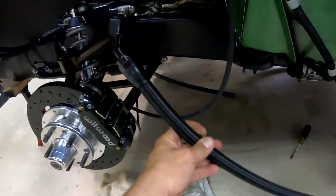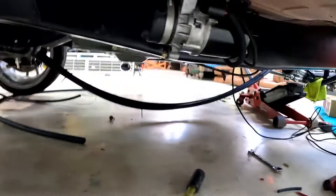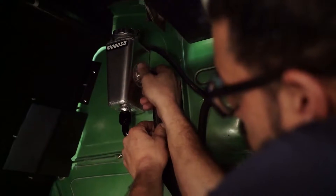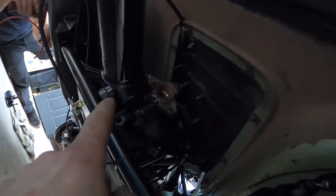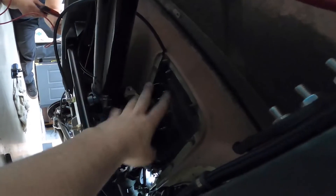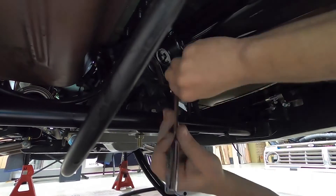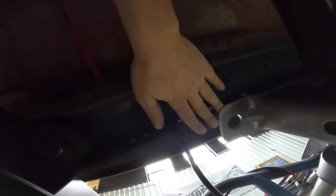We just finished making up this dash-10 hose for the suction side of the power steering pump. It's going to run from our fill point with a 45-degree end fitting down to the pump. While Andrew finishes up the pump, we're going to finalize this two-piece driveshaft. We want to get the pinion fixed down there so the driveshaft line is perfectly straight. We're going to throw some bolts in loosely, jack it up, and figure out what plate we need to make for this crossmember on the cab to bolt the driveshaft bearing to. The bearing falls in the middle of two ribs, so we're going to plasma-cut a nice plate and mark the holes for the bearing to bolt to that plate.